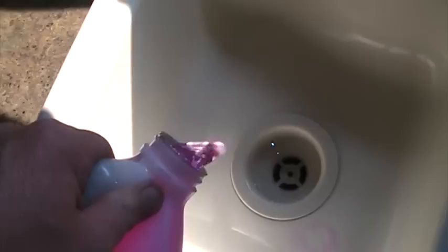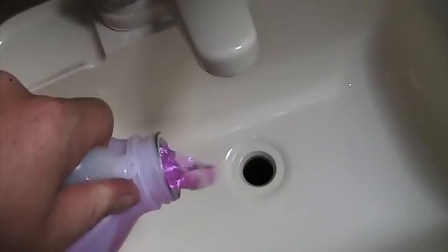You notice you don't need a lot of tools for this — everything here basically just wants to be hand tight, make sure everything's looking good. We'll take just a little bit of our leftover antifreeze out of our jug and dump about a half a cup down each drain. This is just going to help protect our P-traps because they do have standing water in them — about a half a cup per P-trap.